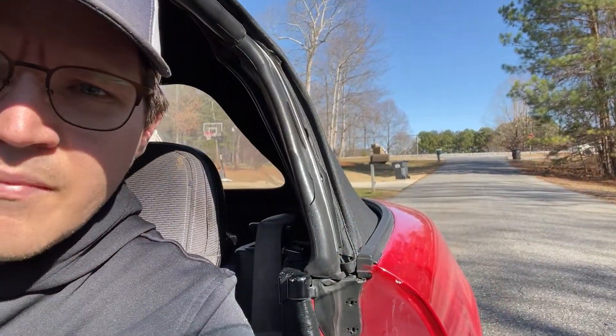The car has an open downpipe right now so it's stupid loud — if you've ever driven a car with an open downpipe, it's dumping right below your seat, you can't hear anything. I pull over, come to a stop, and I can hear the lifters ticking. I turn the car off, go to start it back up, and it won't start — it's seized. I tried to bump start it on this hill but it just locks the tires up in first gear and doesn't turn over at all. Engine's toast.